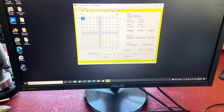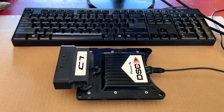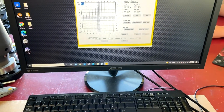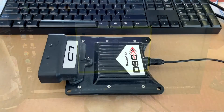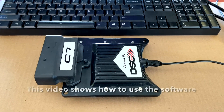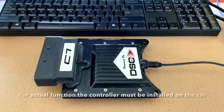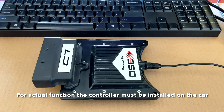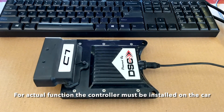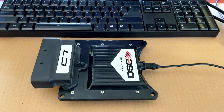This is an expanded video on using the DSC tuner software to zero the ride height sensors. It's expanded because after we zero the sensors, we're going to verify the actual ride height values. For this demonstration, we're doing this with the controller out of the car. Under normal circumstances, the controller must be connected to the car and the car's ignition must be on in order to power up the ride height sensors so it has data.